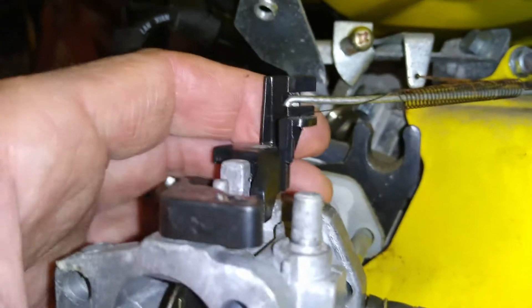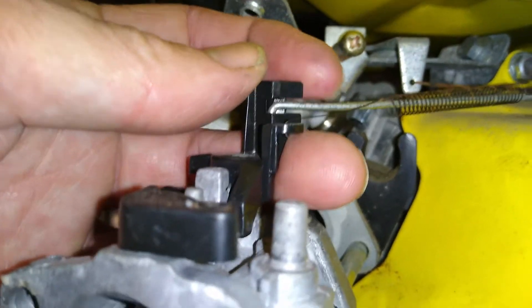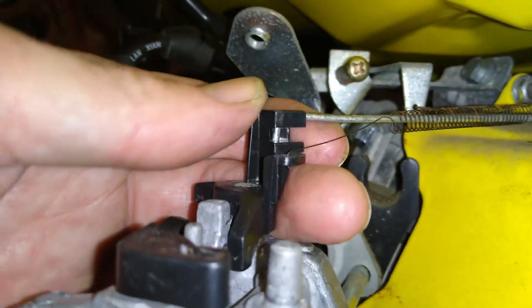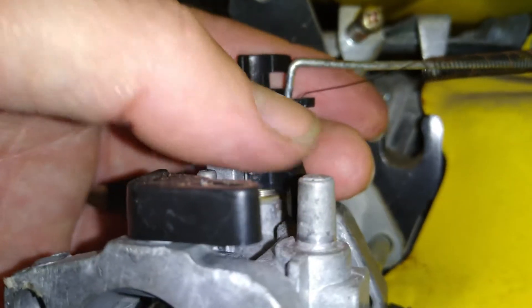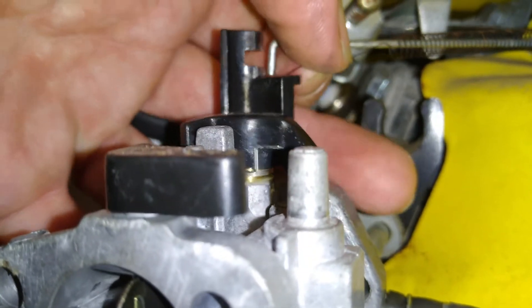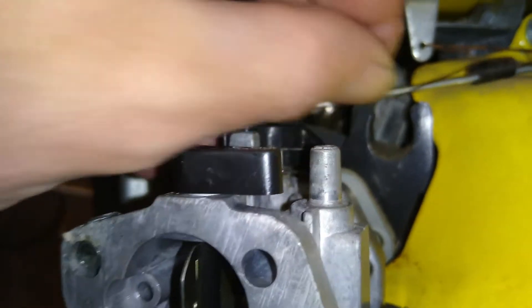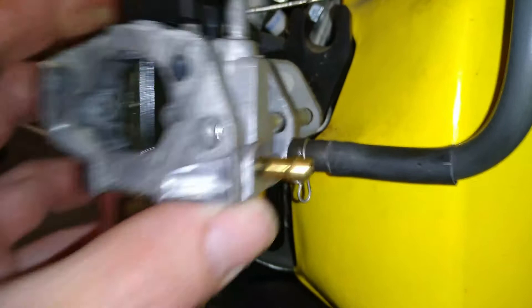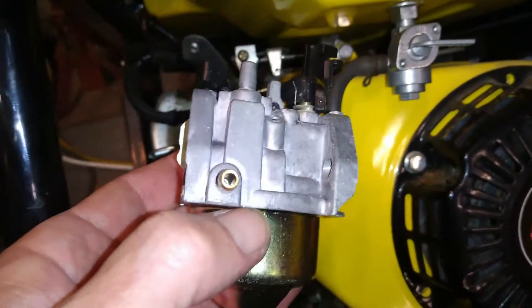Slide your carburetor off and grab your gaskets on the way through. As you lift it out, it'll twist out the throttle at the top and you can slide the throttle lever up from the governor. That one comes off, and then you've got this little governor spring that stops it from hunting — it gives a little bit of tension on the governor and throttle all the time. And the carburetor is off. Simple as that.